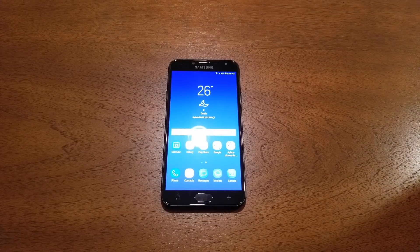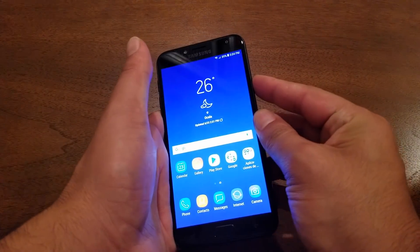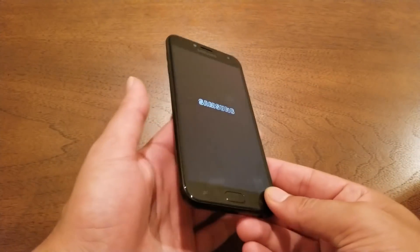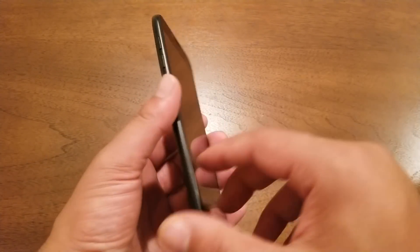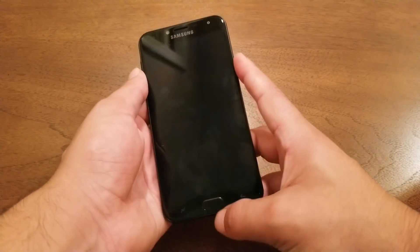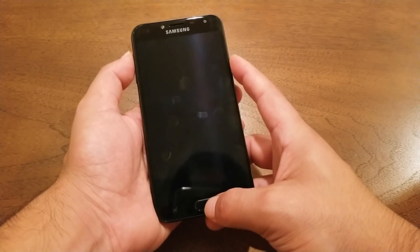Without the Gmail account, you're not gonna be able to bypass the activation screen. Now, as with any hard reset, the phone has to be off. This phone has a removable battery — you can remove it or switch off the phone completely. What you need are the power key, the home key, and the volume up. Press all these buttons at the same time.